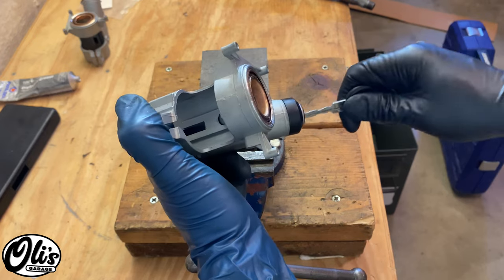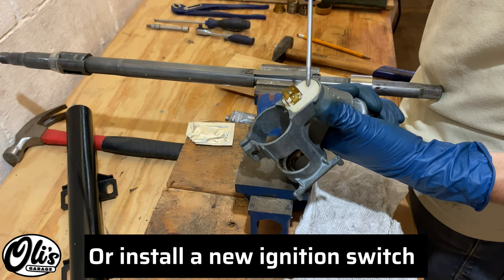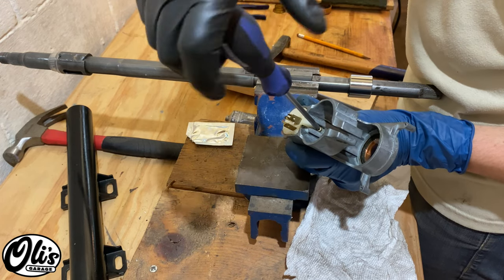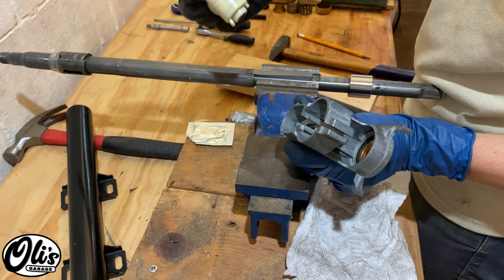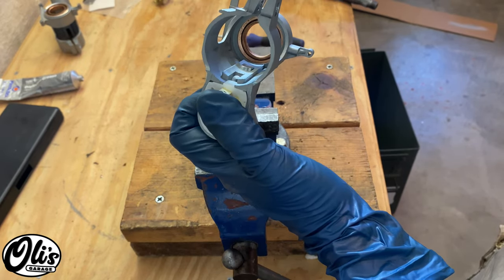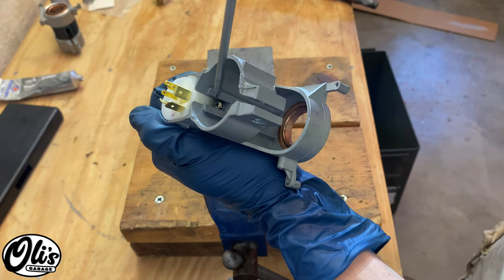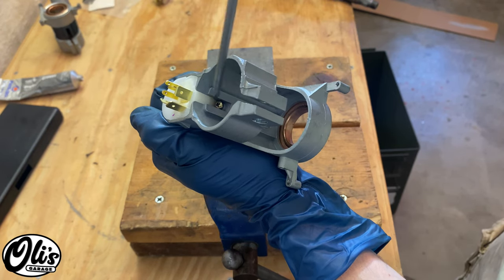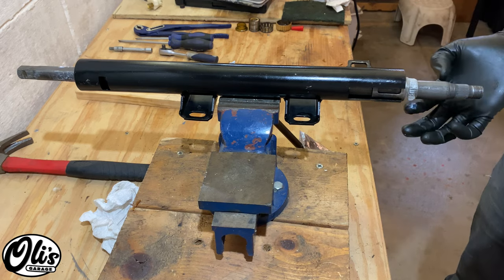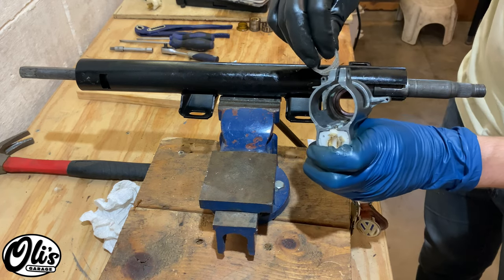While you're replacing these bearings I highly recommend you replace your ignition switch — especially after 30 years of operation these things tend to fail. It's very simple: remove the one Phillips screw, then just pull it straight out, and now we will insert our new ignition switch, slide it in place, and tighten down the little Phillips head screw right in here. This is a little screw holding a little piece of plastic that goes into aluminum — do not over tighten it. Put a little bit of grease on this bushing, take this little bushing right here, slide it off, make sure you apply a little bit of grease to it, and I'm going to slide it inside here.